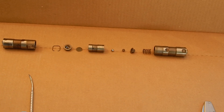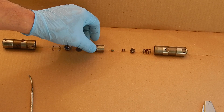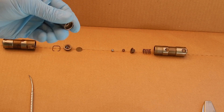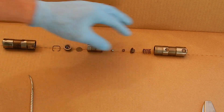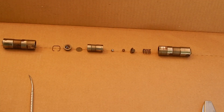These were really, really dirty. I cleaned them up with brake clean, then used lacquer thinner, and also used Scotch-Brite to clean up the outer and inner parts because they were quite grungy. The engine wasn't making any lifter noise, but I did a video on the oil pump a week or so ago and thought while I had it down I'd show this. It works pretty good — a lot easier than trying to bang on them. I hope this works for you guys.